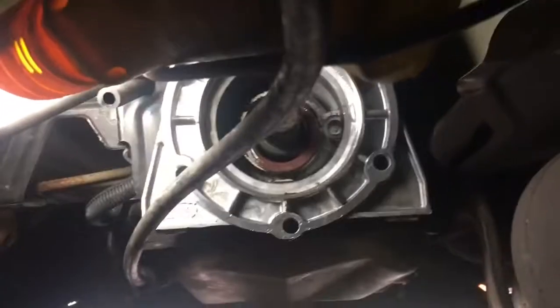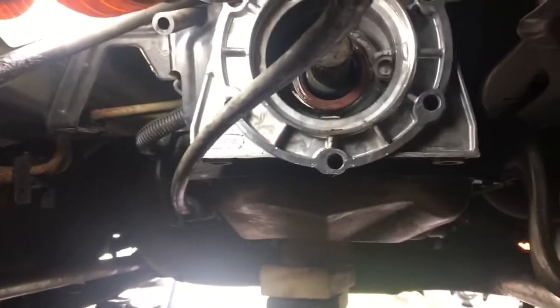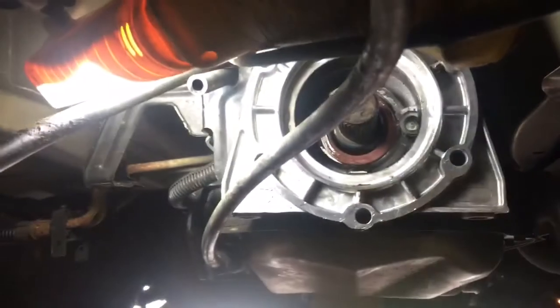This is how to change the rear seal in the back of a four-wheel drive. There's a seal and a snap ring in there — the snap ring was sitting in there upside down. I took a pair of snap ring pliers and cranked it out, then used two picks to pull the seal out. I'm doing the transfer case because I found it was leaking — pulled it apart and saw fluid dribbling out.